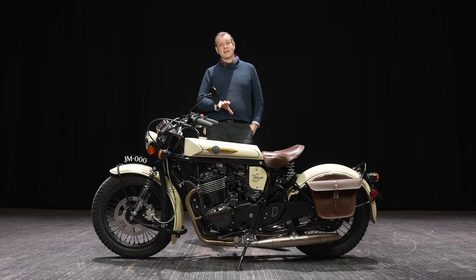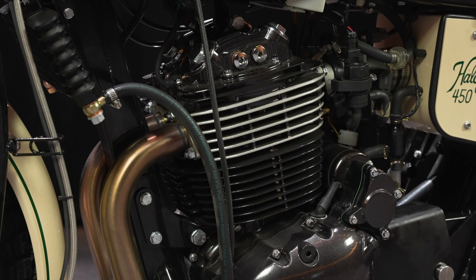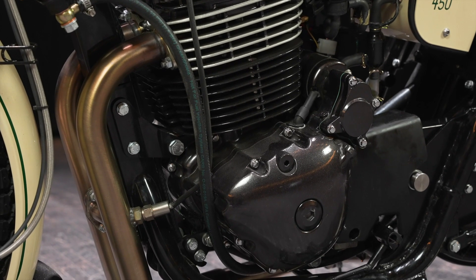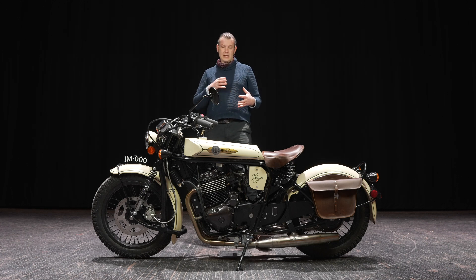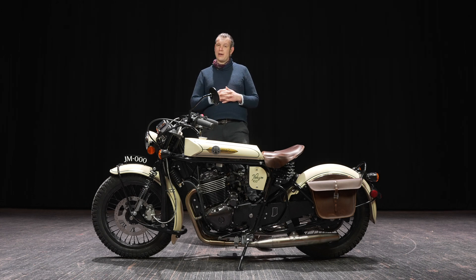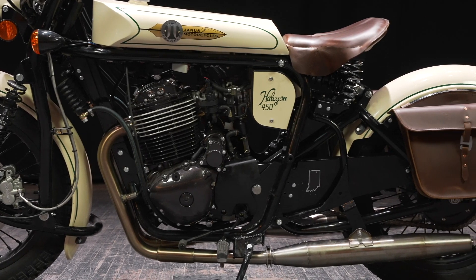The XR400 was an enduro motorcycle manufactured by Honda through the early 2000s, and it has made a name for itself as one of the most reliable motorcycles ever made. This engine was one of the key parts that made that bike so famous — it's a four-valve overhead cam engine. Unlike the original Honda design, this one uses a fuel injection system. SWM improved it, bumping it up from 400cc to 445cc, and handled the extra power and need for additional cooling by adding an oil cooler at the front and adding fuel injection, which allowed them to pass Euro standards.